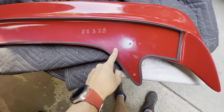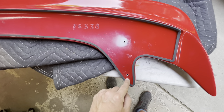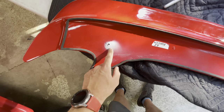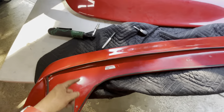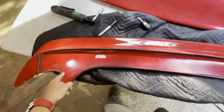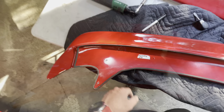Over here on this side you can see the holes are off a bit - this one needs to go down a little bit. I was able to use one of the existing holes, that one seems fine, and then this one is just off a little bit. Reasonably close, but why can't they get this straight? Anyway, let's go ahead and drill a real small pilot hole - probably not even as big as what they used - and drill this out.